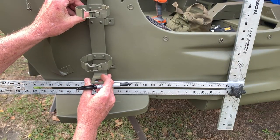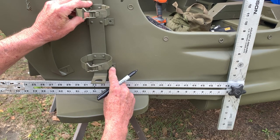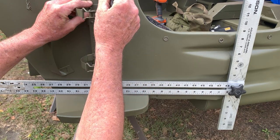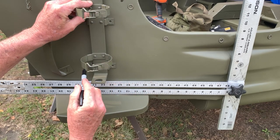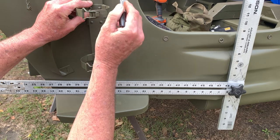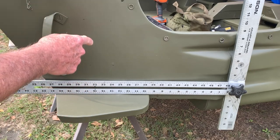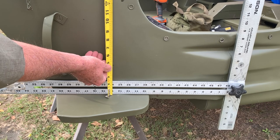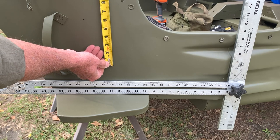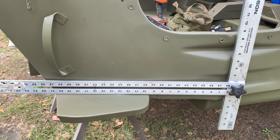Take the bracket itself and line it up with the first mark you made with your sharpie. Use the holes and look at the top of the cowl to line up straight up and down at a 90-degree angle towards the bottom of the footrest. Put a sharpie point right in the center of the holes on the standoffs or feet of the bracket. The first hole is at four and five-sixteenths; the next hole spacing is five and three-quarters, and then to the top is three and a half — the shorter distance of the legs goes towards the top of the cowl.